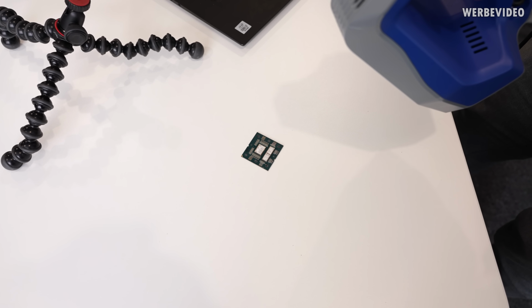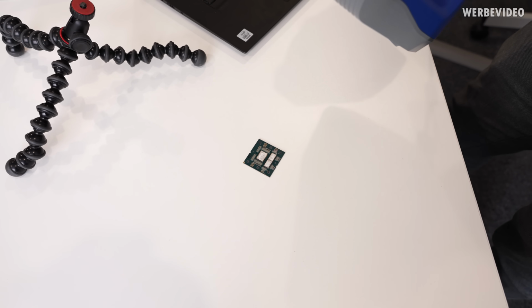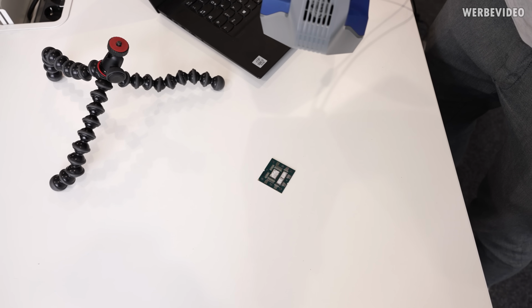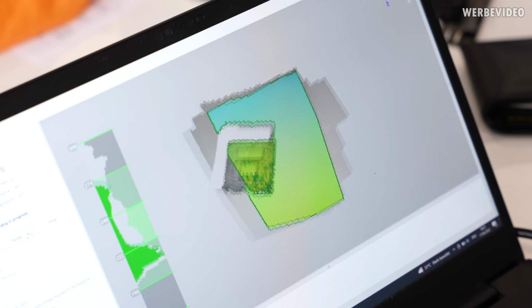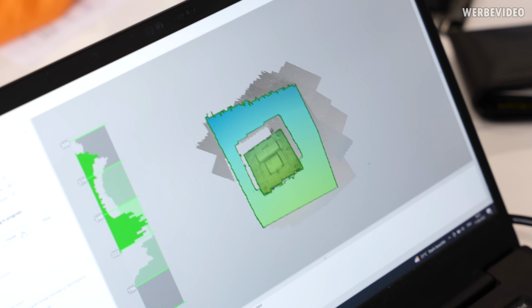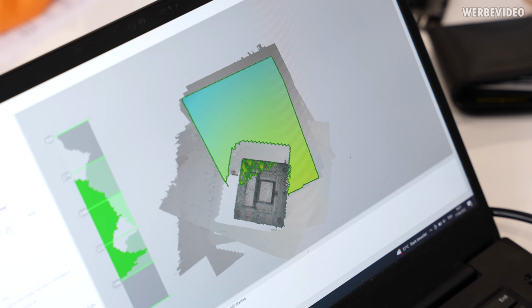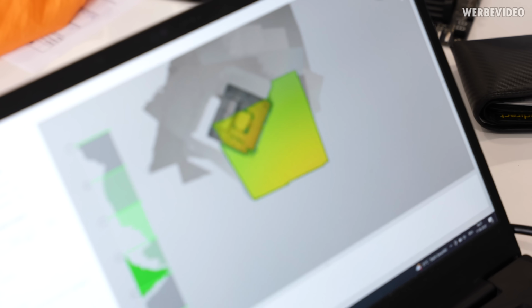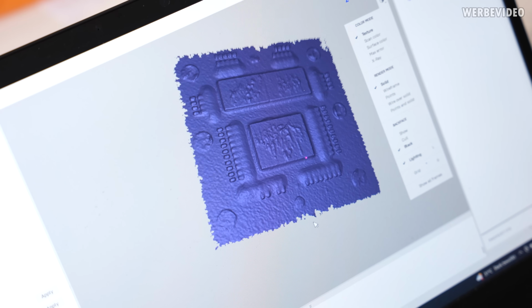Onward we go with our development of the direct die frame. Prior to this, we received CAD files from AMD, which included both the socket and also the CPU. But we noticed during our development phase that the CAD files slightly differed from reality, especially talking about the capacitor placements underneath the heat spreader. That's why we decided to use our own 3D scanner and get a proper scan of the CPU. And you can see this is very accurate.